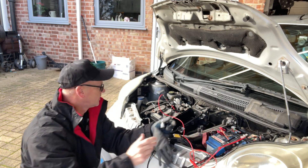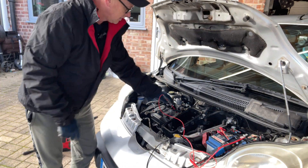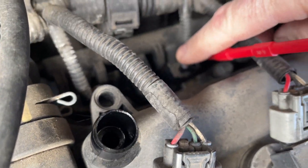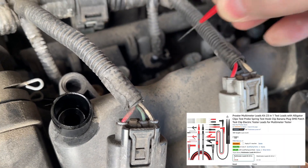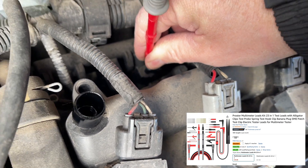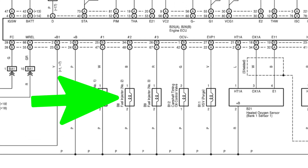What I'm connected to at the minute is the injector, so down the back you've got two wires going into the injector - one on that side, one on that side. I've got my little pin probe and if we pop it into either side, it doesn't matter. We just take it down the side of the rubber sheath there and pop it in.